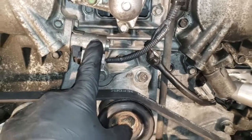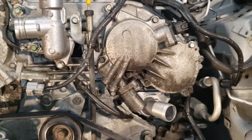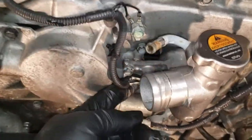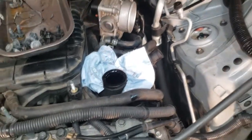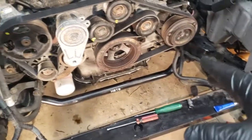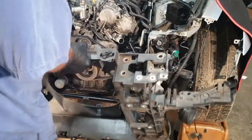I went ahead and rewired all the connectors. I put the dipstick back in. This connector goes there, that connector goes there — it just gets plugged in onto this cam sensor. One thing I do recommend: if you do start to do something like this, take a lot of pictures, even if it means videotaping yourself. I put the bracket back on, all the grounds are back on. I already added the oil and pretty soon I'm going to be able to crank this up. I need to put some coolant and make sure transmission fluid doesn't come out.